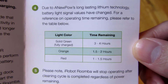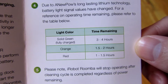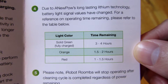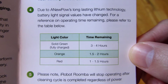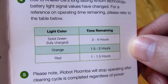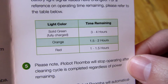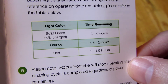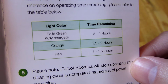Here are the specs: it does charge in three or four hours. But one thing you have to be aware of is that the Roomba itself goes on a cleaning cycle. For my 500 series Roomba, the cleaning cycle is about 45 minutes, and regardless of how much battery life remains, after 45 minutes it will stop and try to return to the docking station. So even though this battery lasts three to four hours, you might have to press clean again to start a second cleaning cycle.